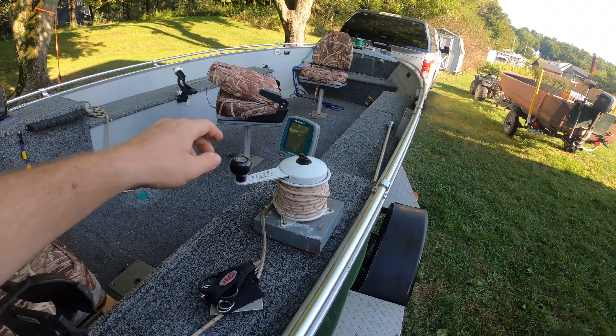Inside this compartment is some of the wiring work. I added a circuit breaker, a master shutoff switch that shuts off everything in the boat except the bilge pump, and I added a positive and negative bus bar and tidied up all the wires — it's much, much cleaner in here. I also replaced the bilge pump with one that has an automatic float switch, which is a big deal. And I moved the drain plug to make it easier to access.